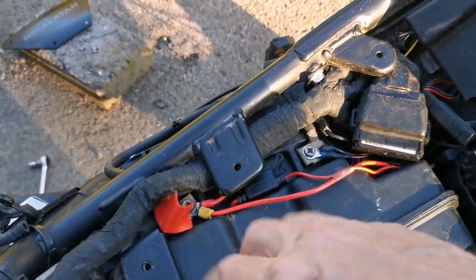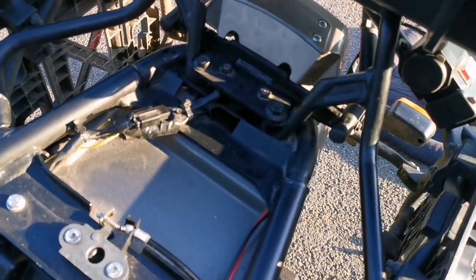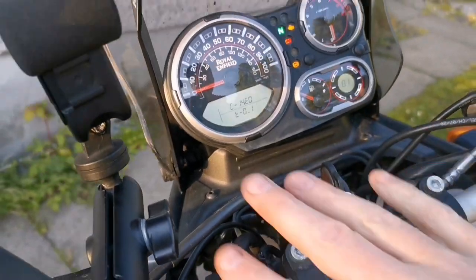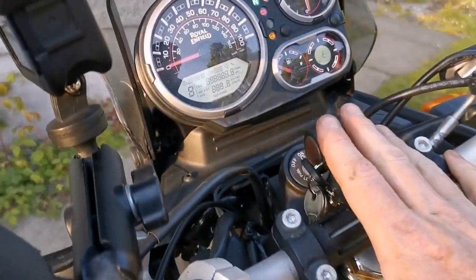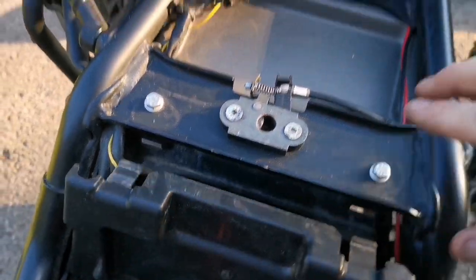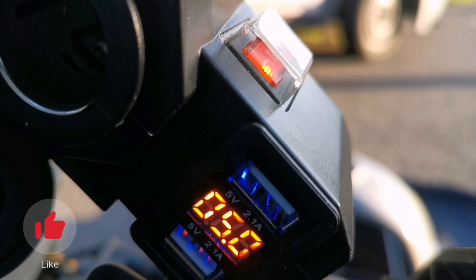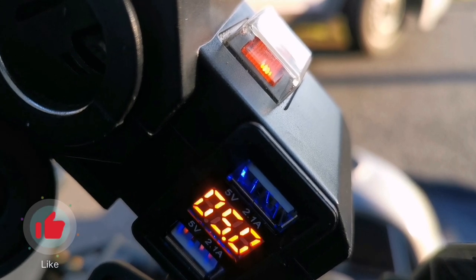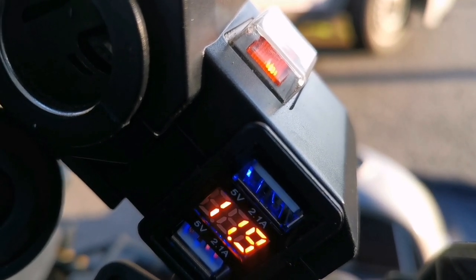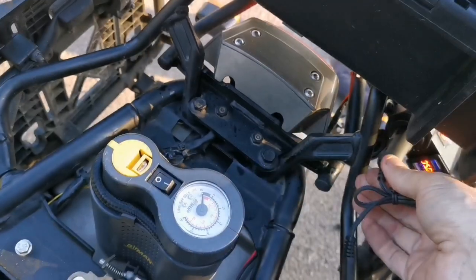I've reconnected the battery temporarily and now I'm going to check this is working. We're not actually going to start the bike since there's no tank — I just want to put the electrics on. We give it about 10 seconds and then this little blue light comes on — you can see that — which means power has now gone to the auxiliary. I turn it on and we can see it's working: it's showing 11.9 volts on the battery, which isn't ideal but I've had it disconnected.